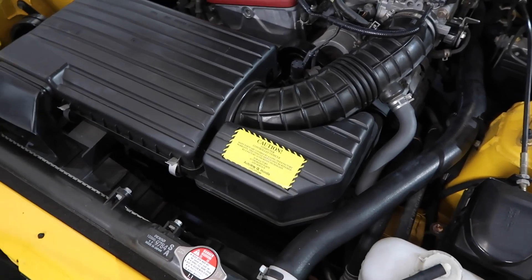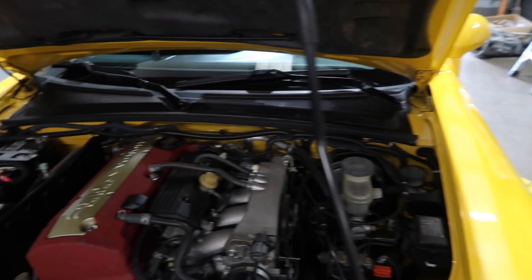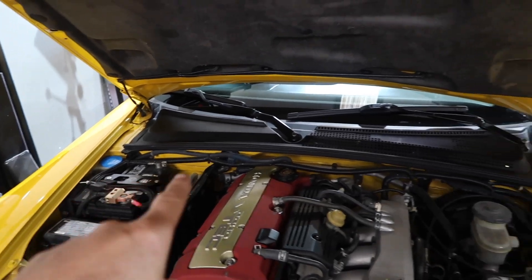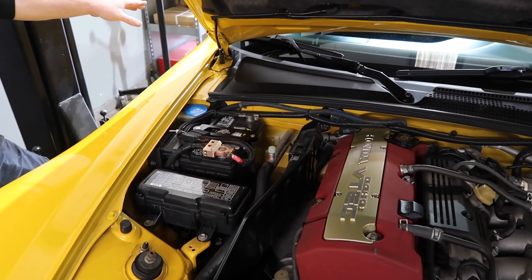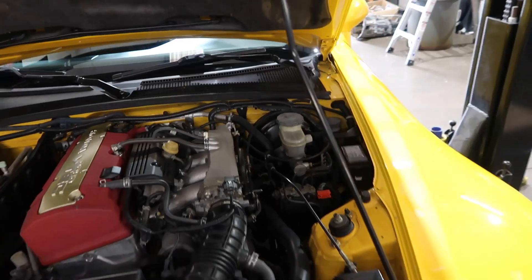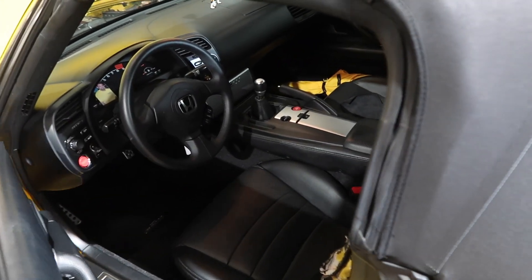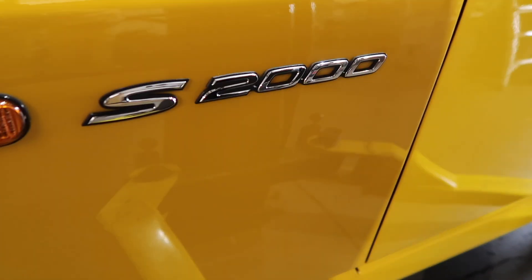We'll just give this a road test and it should be ready to go right away — make sure we did a good job and go over it. You like the stereo wire? It's always my favorite. I just try not to get involved in them because we've changed so many stereo wires over the years — there's a grommet right down there. Send it down that side of the car, don't come across the hot side, then go down that side. The amp is usually on the side of the car anyway because that's where the spare tire is. We end up getting involved and doing all those things for free, and we enjoy it, but we've got to work too. Alright guys, thanks for watching. Hope you enjoyed the clutch with a little bit of shifter knowledge in there and we'll see you on the next video. Don't forget — enjoy your S2000.